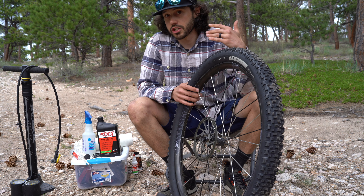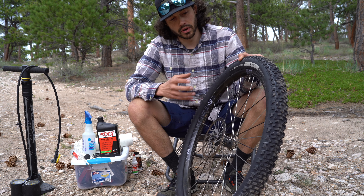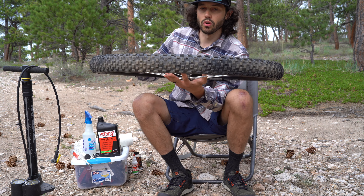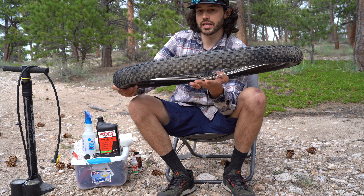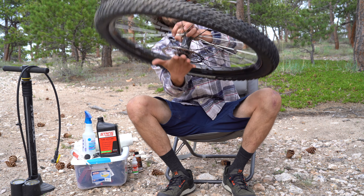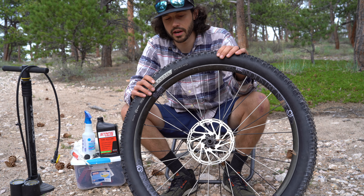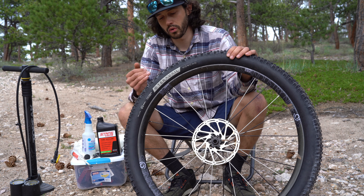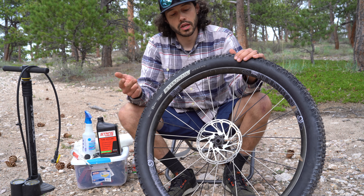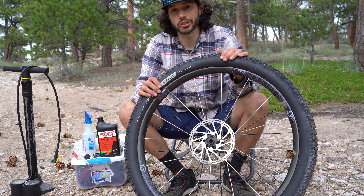The best thing to do is actually go out and ride the setup right away — that way all the sealant can get splashed around among the rim and the tire. If you don't have time to do that, set the whole system on its side so the sealant can soak up between the rim wall and the tire — one side for maybe half an hour to an hour, then flip it over. We're going to go for a ride and cover some trailside repair you might need to do, including using plugs, sewing sidewalls, booting your sidewall, and replacing the tubeless system with a tube. So let's get going.